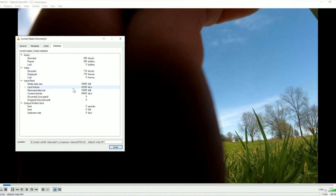The 1080p is 45 megabits per second, and I think that is the explanation. The GoPro Hero 5 Session maxes out at 60 megabits per second, and that is a hard limit whether you're recording at 4K or 2.7K. What that means is that when you record at 4K, you've got a lower bits-per-second-per-pixel ratio and video quality suffers. For FPV with constant fast motion, bit rate is very important, and 60 megabits per second is just not enough for a really sharp 4K image.